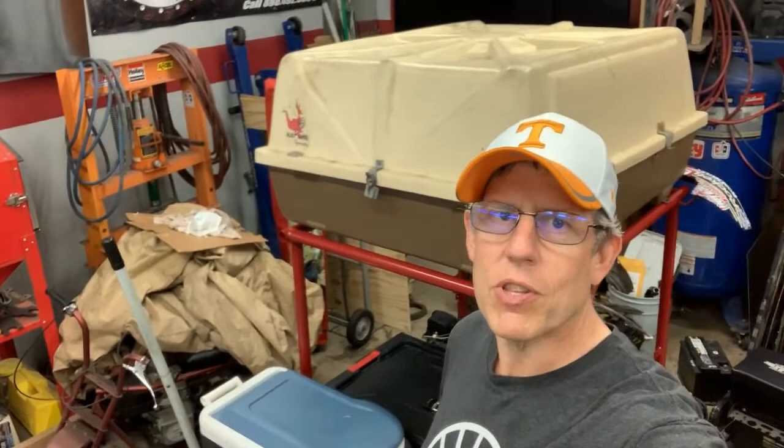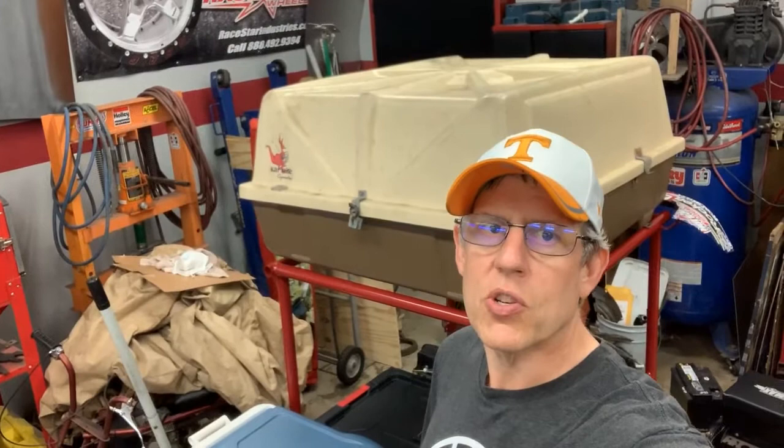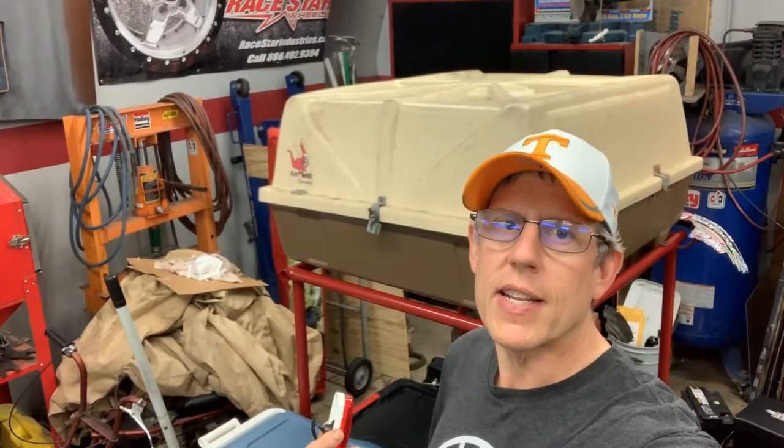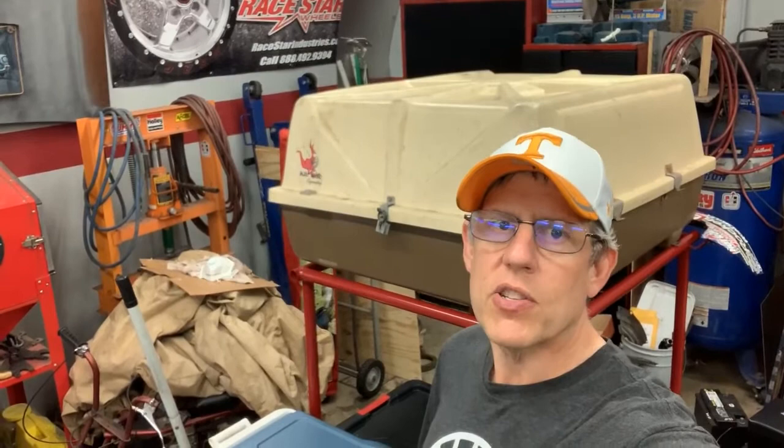The one other thing I am going to do is add a couple of these lights onto the rear spoiler, just as some additional running lights and brake lights, so people don't run into it. The third light on the back here: I switched my car over to LED lights, and the trailer is all LED lights, and the third brake light from the factory spoiler won't work. So I bought a couple of these little cheap lenses, put a couple of little LED lights in them, and they'll work off the trailer now. So I just need to wire them up.